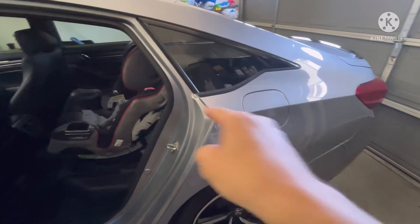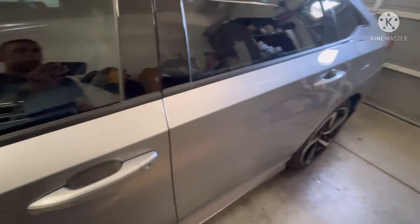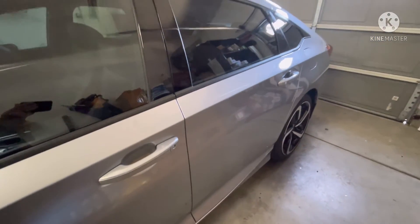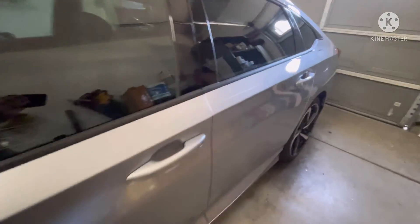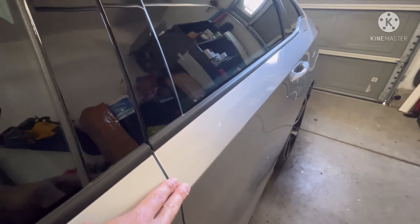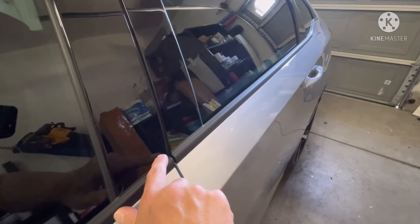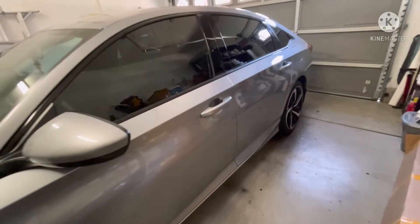It probably shouldn't be misaligned like that, but we know how factory quality control is getting. It's an easy fix. These cars I have are pretty even, but circulating on Facebook I've seen where they dip down. All you have to do is adjust the striker and you can even it out. It might not be perfect, but you can definitely change it — I've seen some with a quarter-inch difference where they step up, and you can lower or raise the door to even it out so it won't stick out as much.